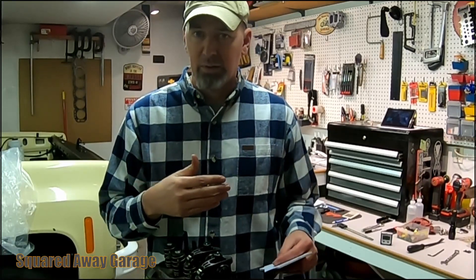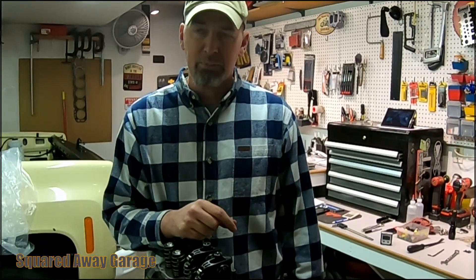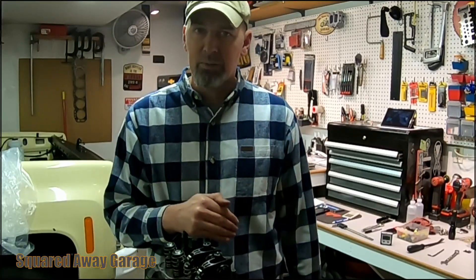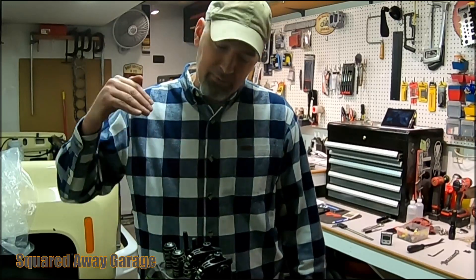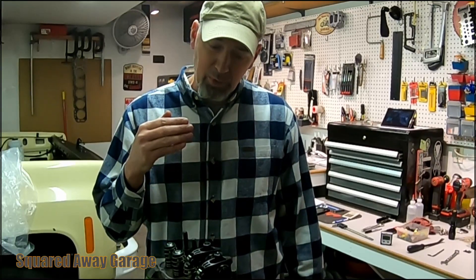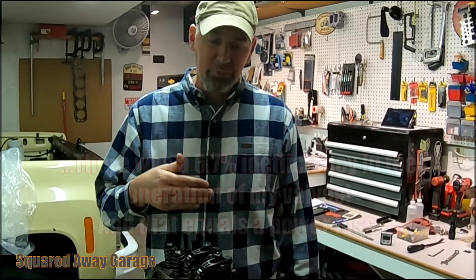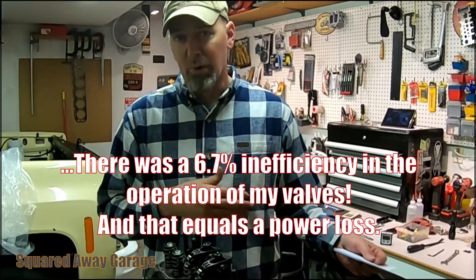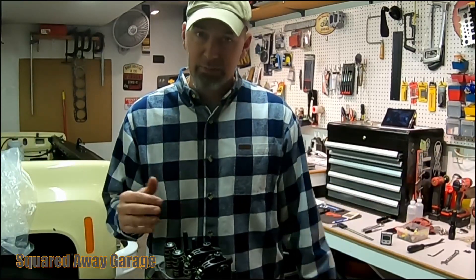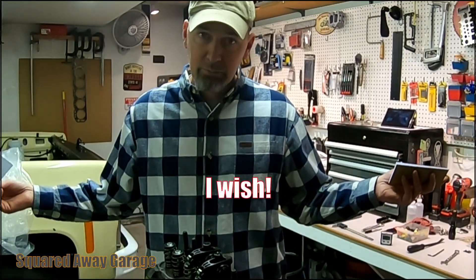If you were talking about changing push rod length by a 32nd of an inch, I don't think you'd see numbers like this. But this engine was running with those push rods — so yeah, it works, but it wasn't working up to its full potential. Now that I get this corrected when putting the engine back together, we make some performance gains. I don't know how much, but it's got to be worth something — maybe 6.747 percent.